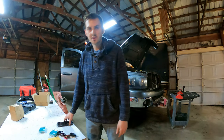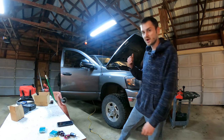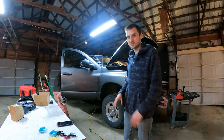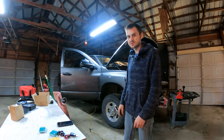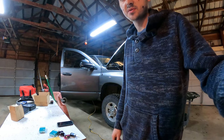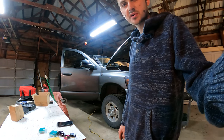So, we are going to get to that. First step, disconnect that battery. And we're going to play with some trim and whatnot before we start disconnecting any connectors, so we don't want the airbag to blow up in our face. So I will come back to you when I've made some progress.